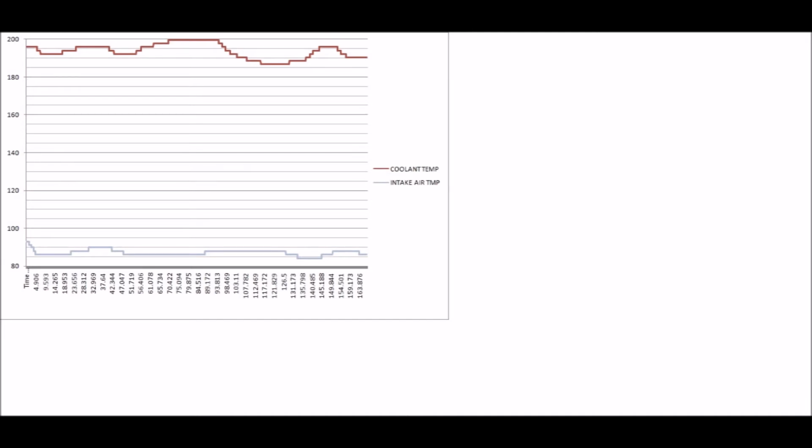That's one. Two, it also depends on other coolant mods that people may do, like put a thermostat that opens sooner than the factory one, run a higher water to coolant ratio, or some people that are really serious about tracking their car, some may even do an AC compressor delete, where basically you're removing the compressor and also removing the AC condenser, which one allows for more airflow into the radiator, and also with the compressor removed off the engine, that takes the load off the engine of the car.